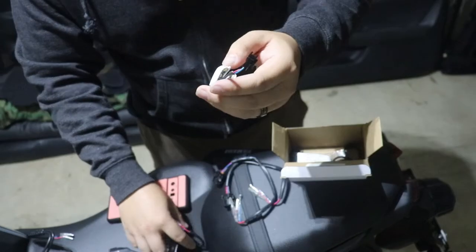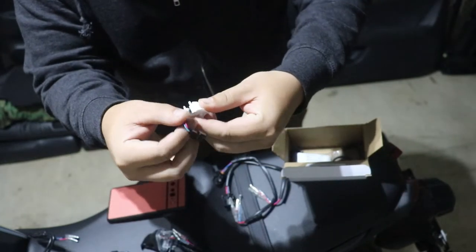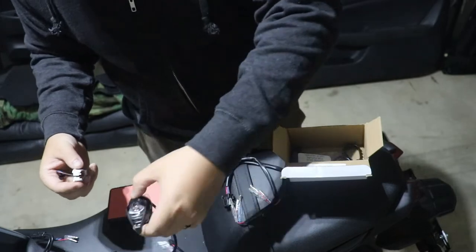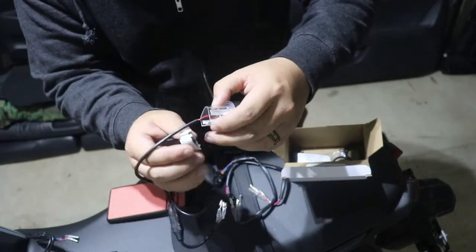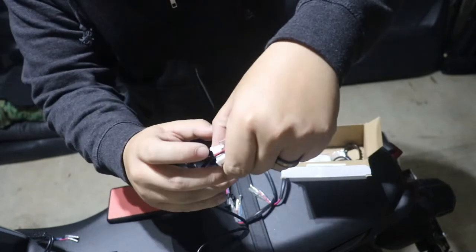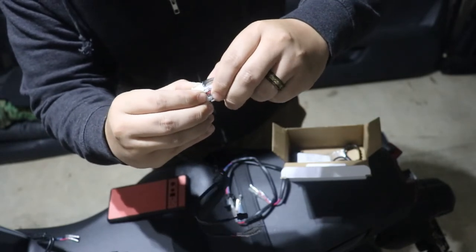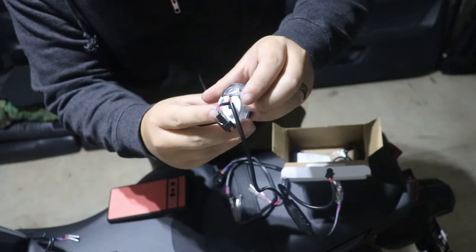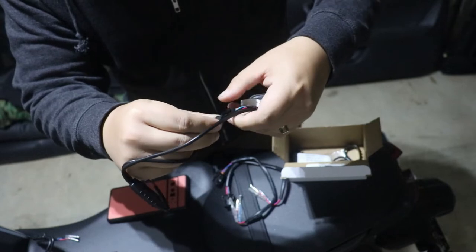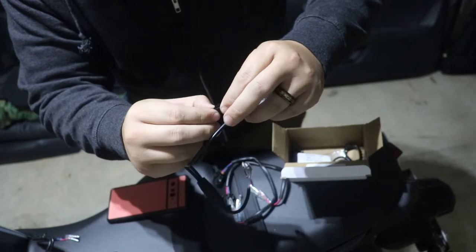With your halo light piece, all you have to do is bend the wires through this little canyon-chasm thing. By the way, these turn signals are not side-specific, so you could put them either way. Take one of them, put the wires through this canyon. You might have to squeeze the sides a little bit to fit — there you go, fit it in. Then the black plug connects over here; just make sure you put it on the right side so it clips in.